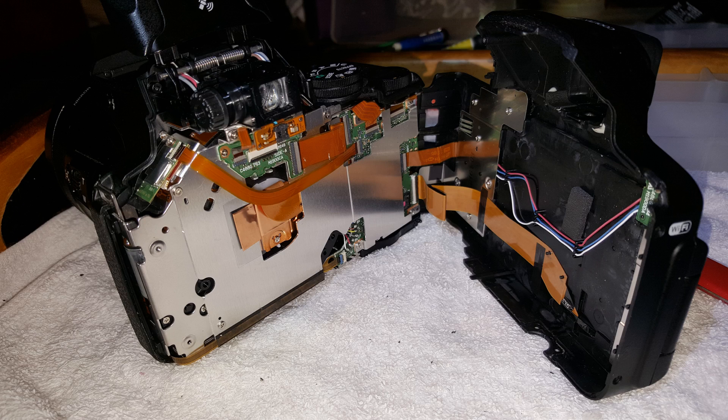Thanks Critical Think for that nice wrap. I'll do this as a quick once-through, but if you want a screw-by-screw instructional, pop over to the video link below. Main thing: remove the battery first so you don't fritz the electronics. Then remove about half a dozen screws — two on the back under the LCD, two on the left side, two on the right side, two inside the flash, and two back screws on the quarter-inch mount at the bottom.